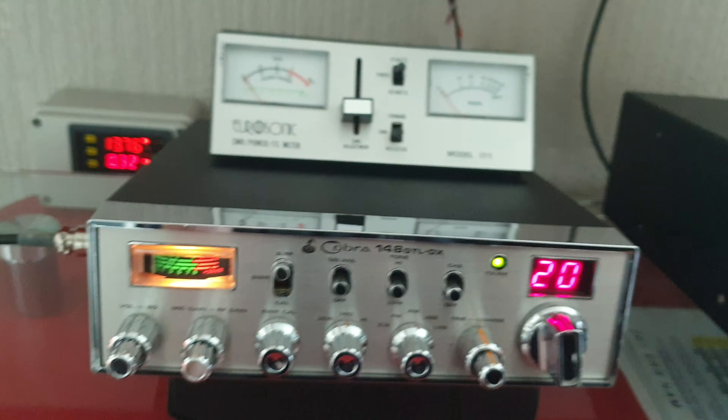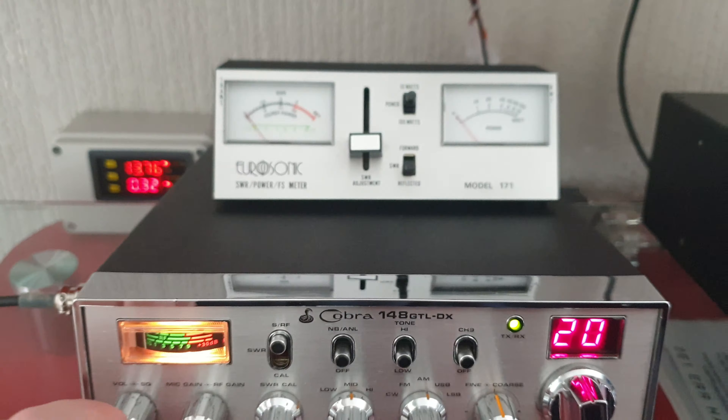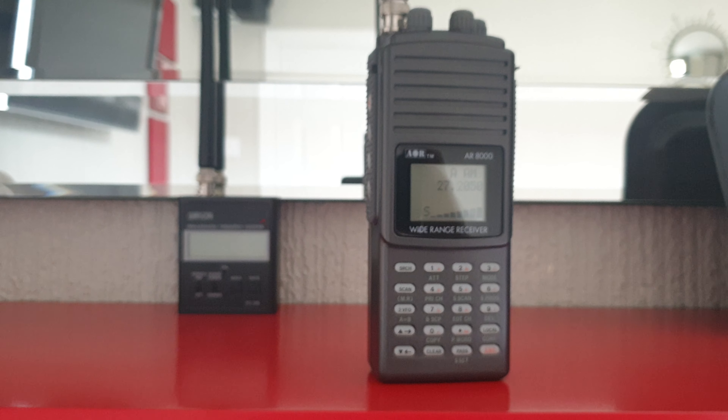Now on AM with the Road Devil — one two three four five, very nice, very clean audio. One two three four five check check. The good thing is you can back it down with your thumb as you're talking. This is probably about the cleanest audio of them all in my opinion. You can check the full review video for more detail. It's got noise cancelling — a bit of rubber over the top to keep wind out. That's nothing fancy compared to modern noise cancelling; it means input noise, not output noise. Probably sounds the best to my ear — cleanest and most punchy.